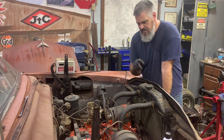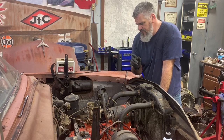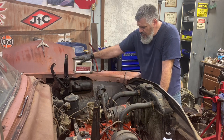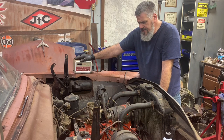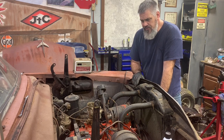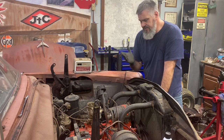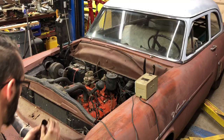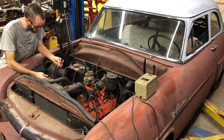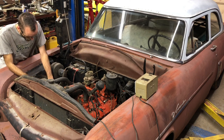We got the starter in and wired up according to the firing order for a flathead V8 from '52. We're going to throw a coil wire on it and take this old 6-volt battery charger to power the coil, but we're going to run 12-volt through the starter because we're just going to see if this thing starts. We'll put this coil wire on, check for spark, and then see if it'll fire. It might just fire when we check for spark.